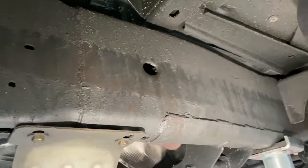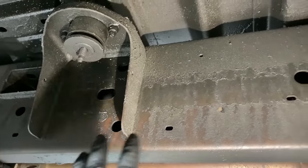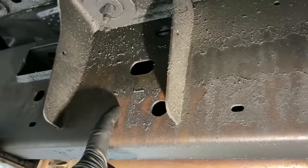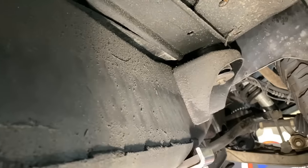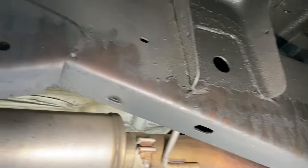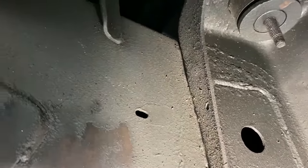Let's take a look at the outside of the frame. Of course the outside of the frame gets hit much harder than the inboard side. Up top there, the body and floor pan looks good. On the frame there is some wash-off after a year, but it still has that oily coating on the metal. You don't see big pops of rust, and it does not harbor moisture to help rust grow — it actually lets it breathe but still nourishes the metal with that oily wool wax lanolin substance. Same thing all the way back on the sides — got a little wash — and back here it looks good, dust making it a little thicker.